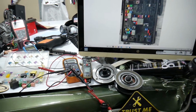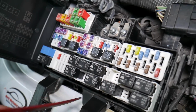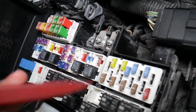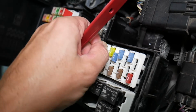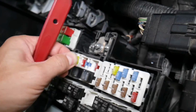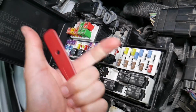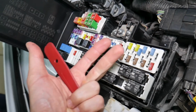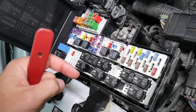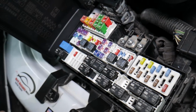Before we continue, let's explain quickly why it's always a good idea to test fuses and relays. It is very important to test fuses and relays. On those fuses you cannot clearly see if they're burnt or not, especially the J-case fuses. Let's say you remove a fuse, look at it, and assume it's a good fuse, but it's actually a bad fuse. Sometimes you cannot clearly see that. What can easily happen is you put the bad fuse back in and start replacing parts and tools that you don't need to, so you lose your time and your money to fix a problem that doesn't exist, when all we had to do is test the fuse and replace it. We'll put a link to a special video that will teach you how to test fuses and check relays very easily as well. Check it out, it will be in the description of the video below.